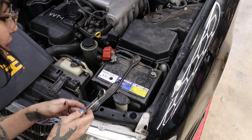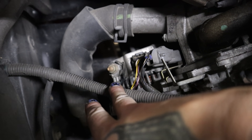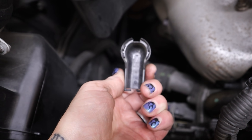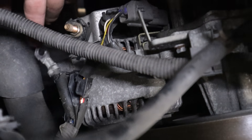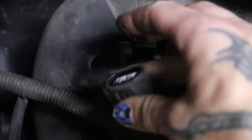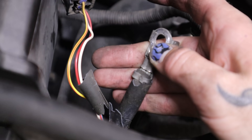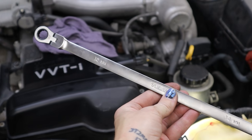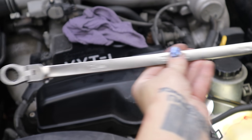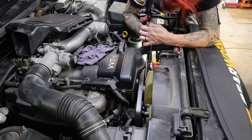Let's check out the alternator. Before we touch it, I'm going to go ahead and disconnect the battery. Next, we've got that 12 millimeter nut underneath this little plastic cap that just pops right off. We're just going to pull that wire off of there and then we've got this connector right here. While we've got it here, let's just make sure all of our pins are good — there's no corrosion there. I will check for voltage drop. You can see the tensioner right here — there's our tensioner pulley. This is one of my favorite Toyota wrenches: one side is a 12, the other side is a 14. I'm going to use the 14 side to release that tension on the belt and pull the belt off so I can remove the alternator.